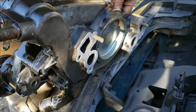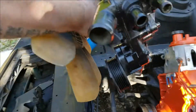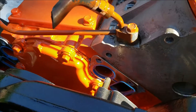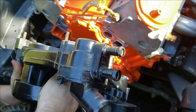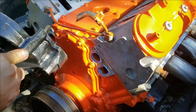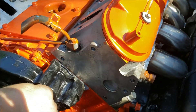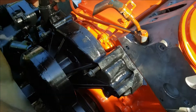An easy way to do this is to start two of your bolts in the pump first — that way everything goes in pretty good and lines up easy, and you don't have to fight with your gaskets. Quick note: the pump was upside down the first try — take number two. Two bolts started in — easy peasy — see how the silicone helps out.